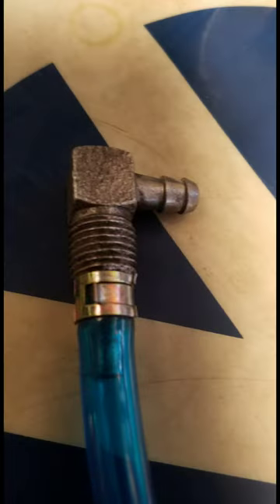Here is what the squeeze clamps look like with tabs cut off to fit through the fuel tank opening. I added an extension of pipe in the hose to allow the filter and line to hang closer to the bottom of the tank.